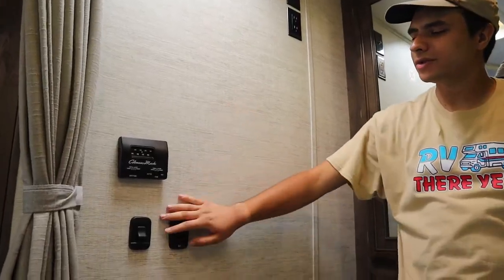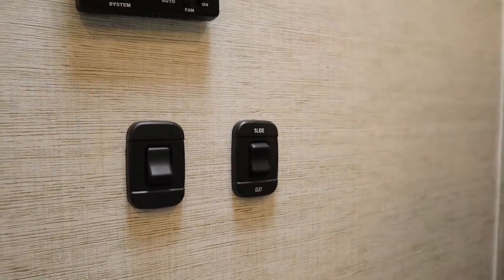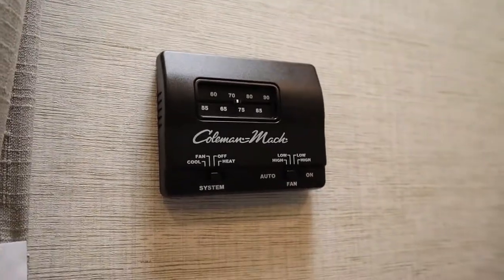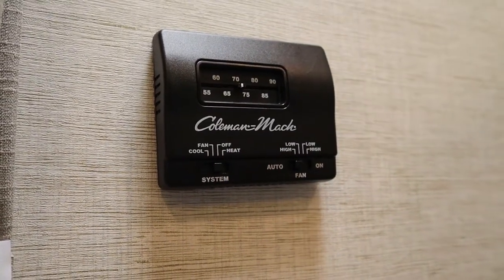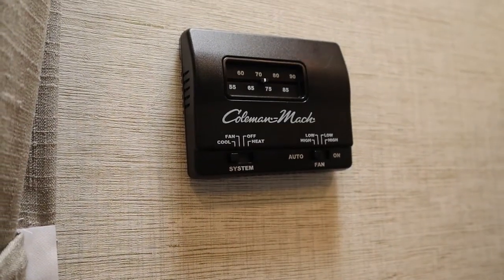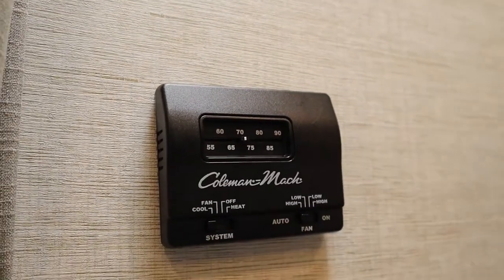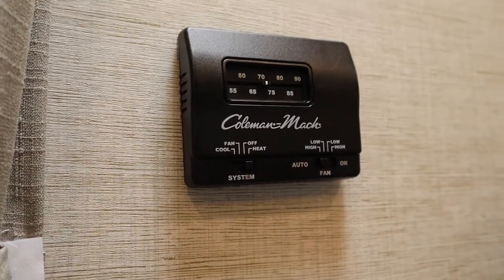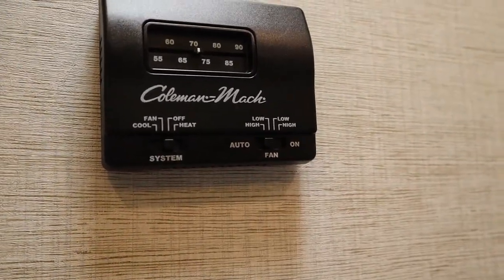At the foot of the bed here you have a few switches — one for the ceiling lights and one for the slide out, with a switch also on the control panel. This here is your thermostat, which controls the AC and the heating. To turn on the AC, make sure you have the generator on or you're plugged in. Switch it to fan and then to cool — you'll hear the unit on the ceiling go on and you can control the temperature. If you want to use heat in the winter, you won't need the generator or be plugged in — it just runs on the propane and the battery. Here you can also control how powerful the AC will be.